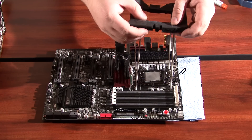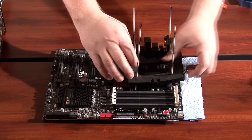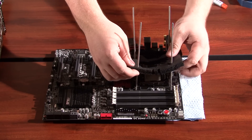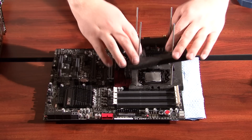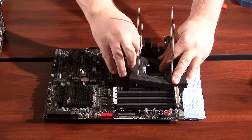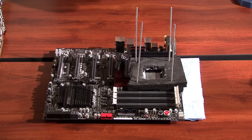For insulating around the CPU socket, I use 1.5-inch closed cell foam, which I cut areas out of in order to fit capacitors and other components on the motherboard. I follow up with a second layer of closed cell foam with a cutout for the CPU. This helps prevent condensation from forming inside the CPU socket.